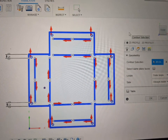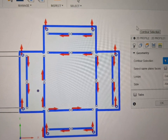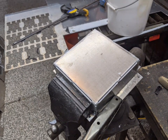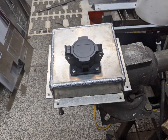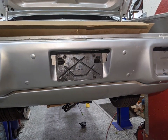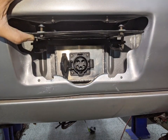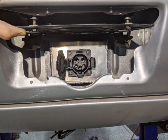And a little more design work — I needed a box. I don't have a brake, so I just make relief cuts so I can fold it up. This is an aluminum box that's going to mount the J1772 charge socket. I needed to bring it out just a little bit — I didn't want to drill into the back of the trunk, so this is going to mount just behind the bumper. I welded it back up, then mounted the charge socket to it, and it fits right behind the license plate. This is the original fuel filler area — a lot of cars in this era had a spring-loaded license plate, so you just flip it up and the charge socket fits right behind it. It's got plenty of room for the big locking J1772 charge plugs.